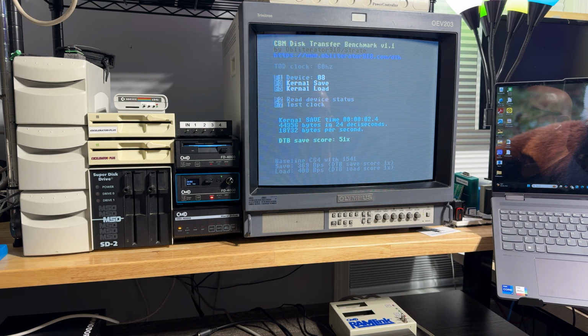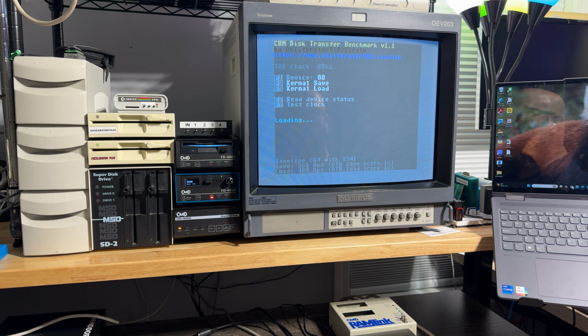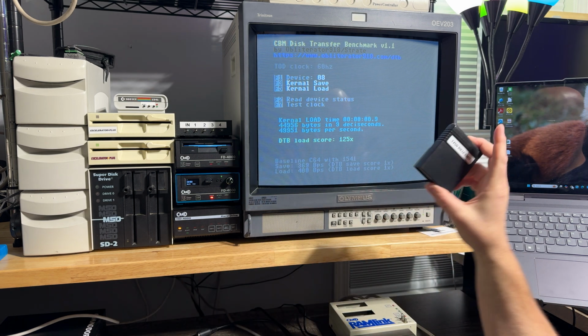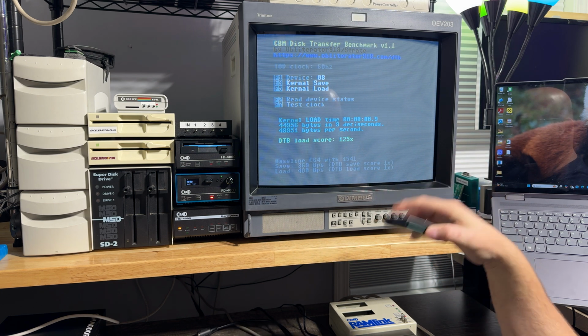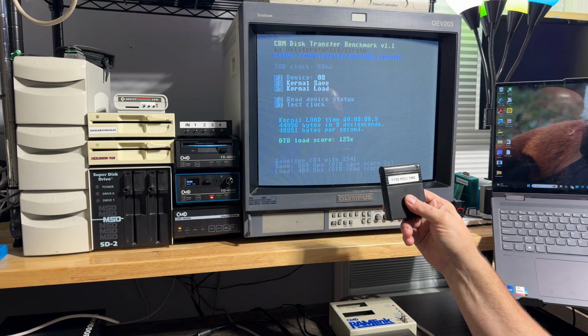And you'll notice something interesting here. Only 51 times. Okay, 18,732. I'm going to hit F5 and it's 125 times. That's way less. It's one tenth of the speed that we were at with this. This plugged into the RAMLink is almost 10 times faster than the internal RAM cards. So just make a note of that.